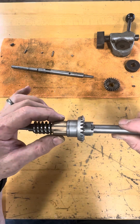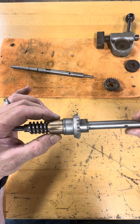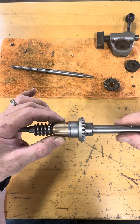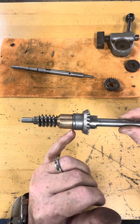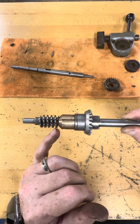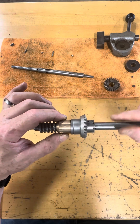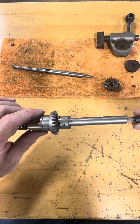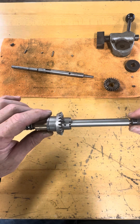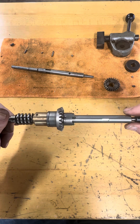This bearing is going to be locked inside the head assembly, and the shaft is going to need to spin freely within it. So if necessary, you can get some very fine sandpaper or some emery cloth and face either end of this bushing. Just make sure that it rotates on that shaft freely and that this piece goes back and forth easily.